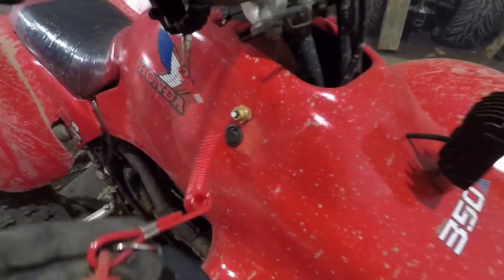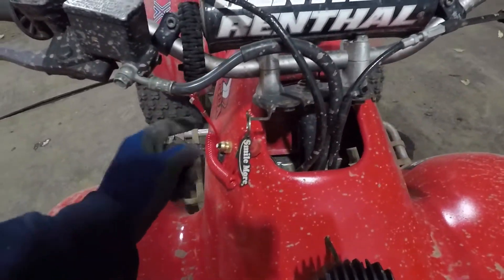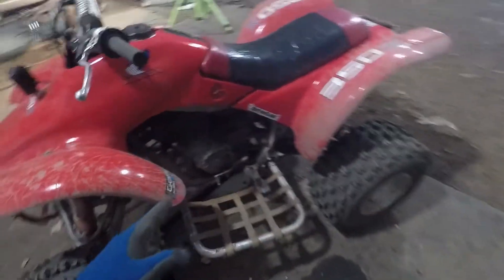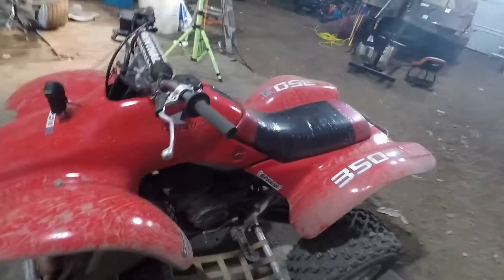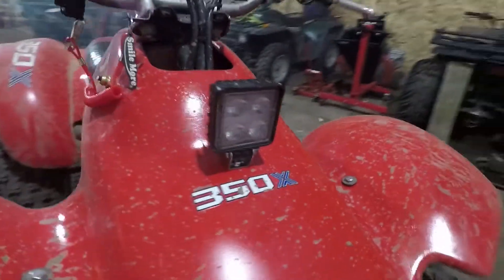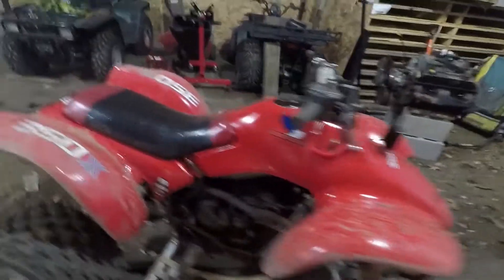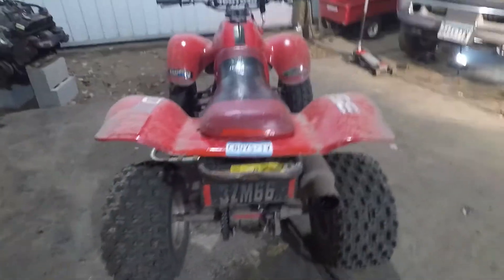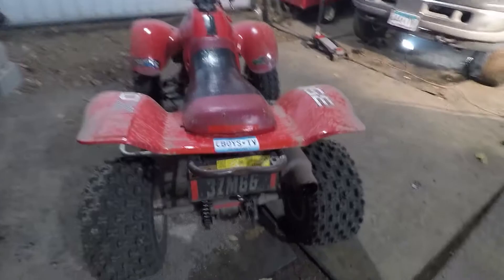This is some of the rewiring that I did. It used to have the control box but that was just shot — didn't work at all. So I rewired it to have a tether in case I fall off. Whoever built this with the 350X engine put the on/off switch right in here — just a little toggle switch you had to reach down and hit to shut it off. I switched it to the tether instead. Got new grips on it, new clutch lever. This thing never had lights when I got it, so I put a headlight on, which still needs to be wired up — that'll just be a little switch off to the side. It also has no taillights, but I put reflective tape on there so if somebody comes up behind me they can see me, and eventually I'll get a taillight, maybe.